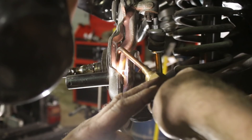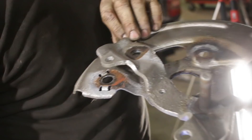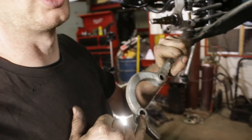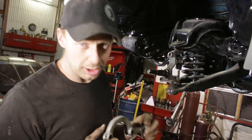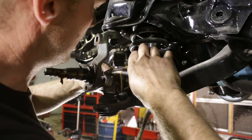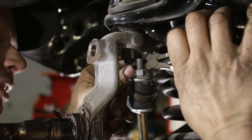This used to be a 19, now it's an 18 — so we won't be reusing that. Luckily they are for sale. You do have to reuse this piece. Now it comes with half-inch grade 8 bolts in the new kit, and some of these holes aren't half-inch, so you might have to drill them out. Stick them in a drill press and make sure you're nice and straight. I think Right Stuff does sell these for about 60 to 70 bucks, but I'm just going to drill it. Same idea with these cotter pins — they always install it the easy way, which makes it the difficult way to remove. When you remove it, it's seized and rotten.